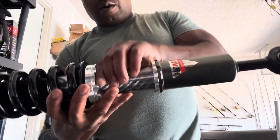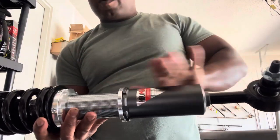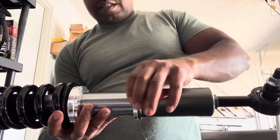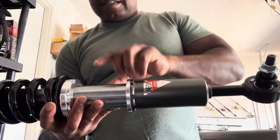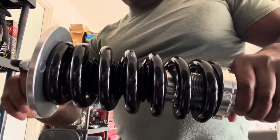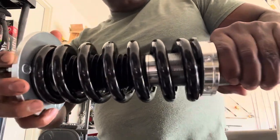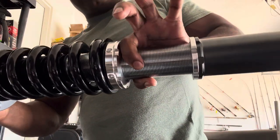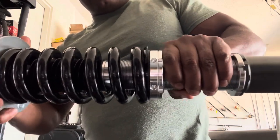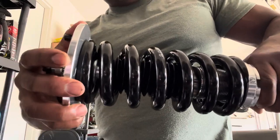Let me show you what I'm talking about. When I hold this body right here, that's similar to this being cranked down right here and this being one, meaning this is secured, this is locked down, and this is now one. So I'm going to hold that and cause that same effect. Now, if I were holding this and the car is turning, it wants to do this. See, I'm holding the body of the coilover, it is not turning, okay? Just this top is. There's a bearing in there that needs to be able to move